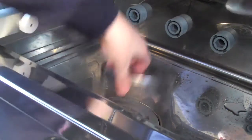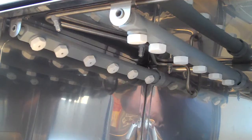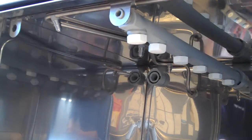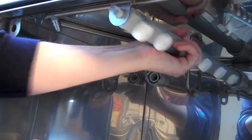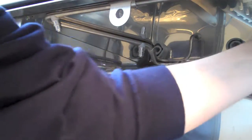Finally, remove the scrap screen from the center of the machine and wipe up any excess residue that might appear. The process is similar for the upper spray arms. Give it a quick quarter turn to the left, pull towards yourself and pop out. Do the same thing again for the center spray arm — quick quarter turn, pull towards yourself, the end will pop out. Do the same thing for the third spray arm on the top right corner of the machine.